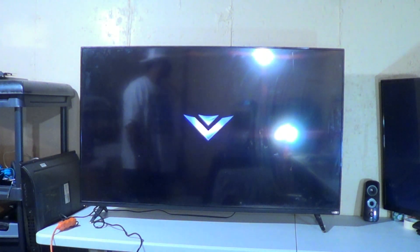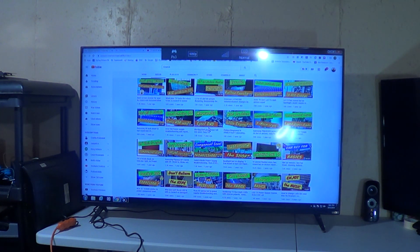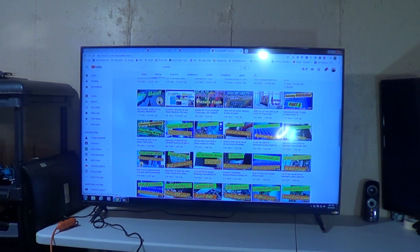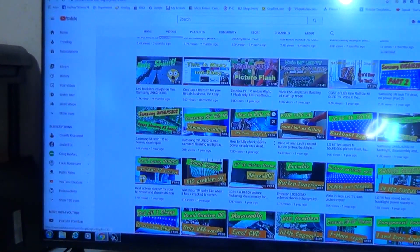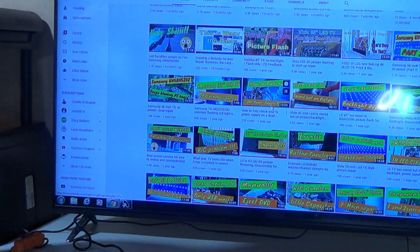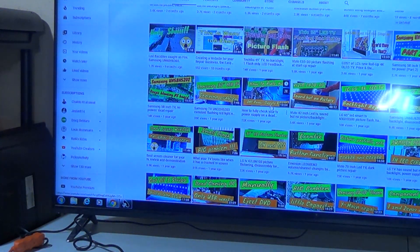Now we've got it all back together. I know a lot of you are going to say those are the lights in the background — those are not the LEDs, the lens covers didn't fall off the LED lights, nothing like that. One thing I wanted to point out is that this TV has automatic dimming when you walk in front of it — in case you turn the lights out, the TV automatically dims to save power. I'll show you: I put my hand in front of the little sensor, it gets dark; I move my hand away, it gets bright. So don't let that fool you in case you repair it and then start walking in front of it and it starts flashing — that's just you walking in front of the TV.